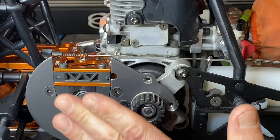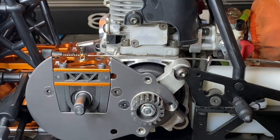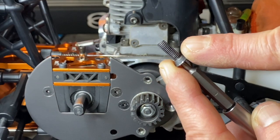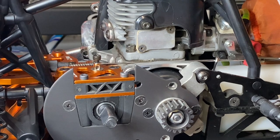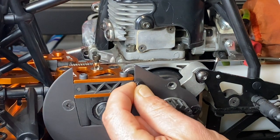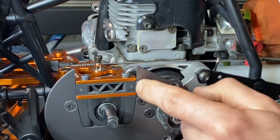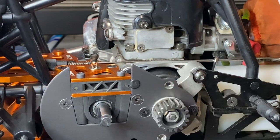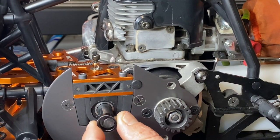That's what you're looking for — buttery smooth. Now we can go ahead and put the screw back in here with some Loctite and get her cinched all down tight and right. Don't forget to alcohol clean your screw as well. And what so many forget — don't forget your little rubber dust booty. Also your spur gear spacer. Can't forget that one, son.